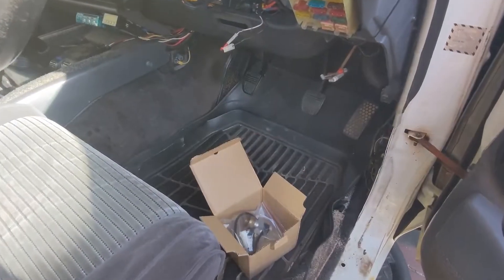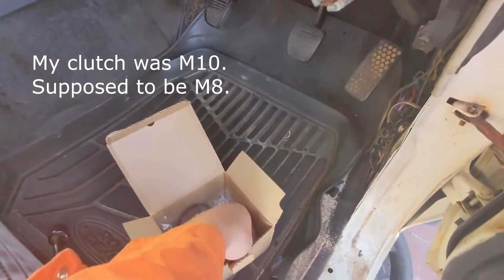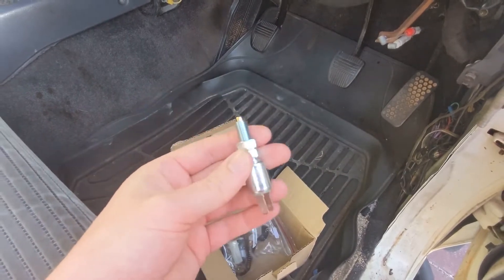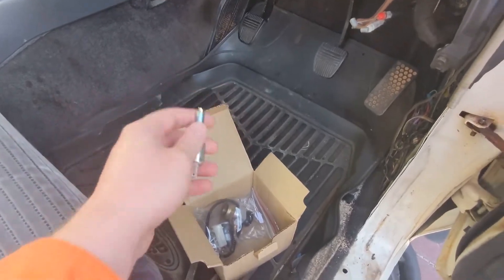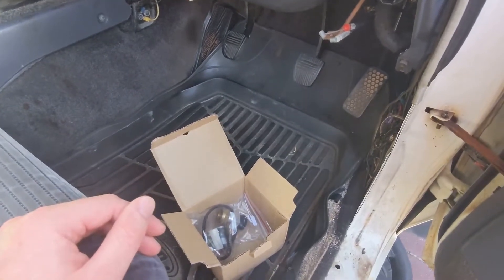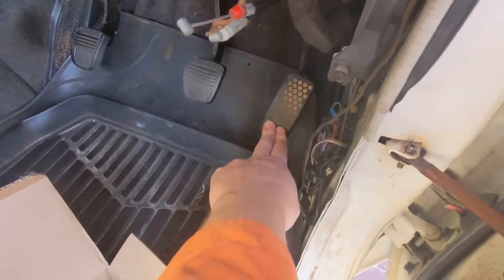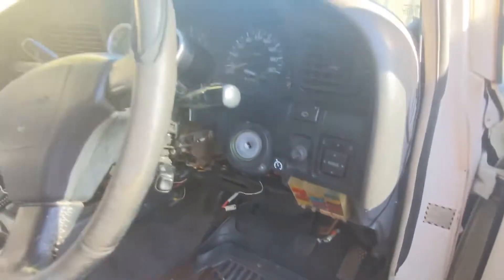It's been about a week since the previous video. I tested the cruise control by bridging the clutch switch, and I've now received my new clutch switch which is an M10 one — this winds in where the old stopper used to go. It's an old metal switch, very nice, similar to the other one I showed but M10 rather than M8. When I was testing it, it was still a little bit jerky, similar to what was happening with the old mechanical setup. It's definitely a lot better now with the electronic setup — the pedal isn't getting pulled in and out — but there's still room for improvement.